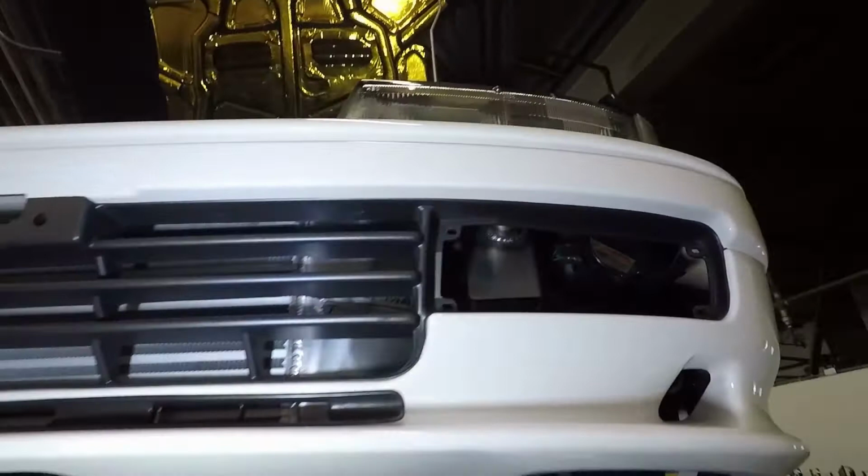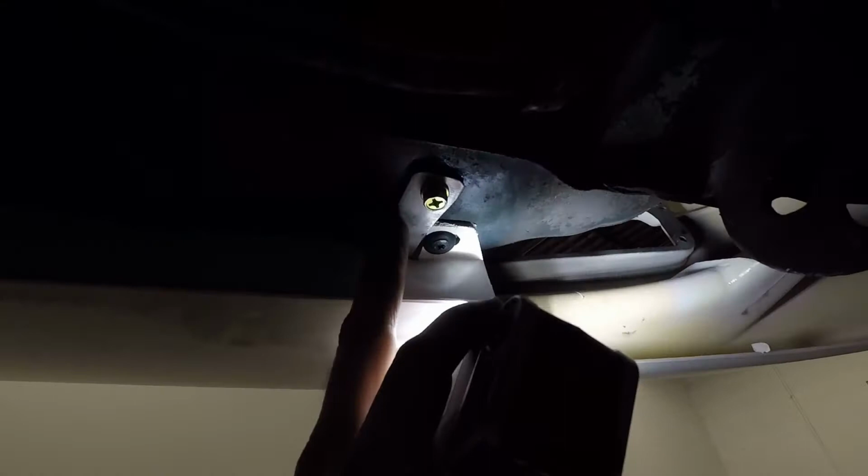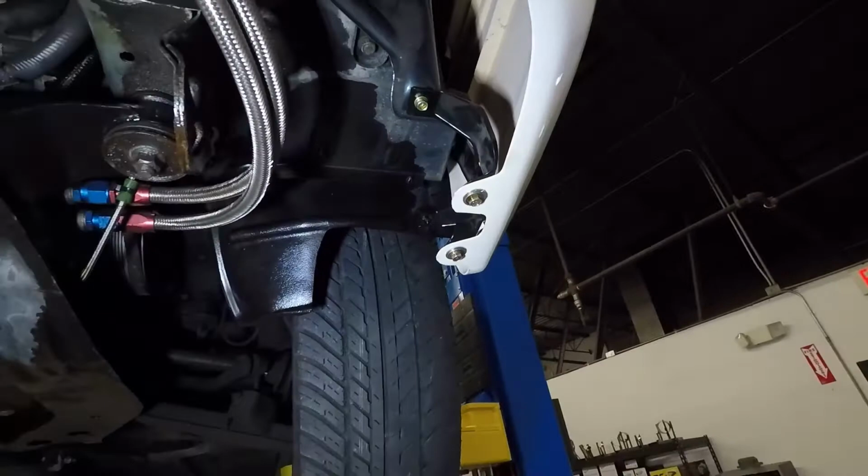It's really clean fitment. The one thing he just had me do, because the customer is really particular about rigidity on the bumper, and this thing is really solid now, but he wanted a little bit more rigidity, so I ended up building these little support brackets that are bolted right here and to that lower air dam bolt to give it a little more rigidity as well. But overall, it bolts right up to pretty much all the factory connections that are available, given that this is a USDM model car and it's a JDM front bumper.